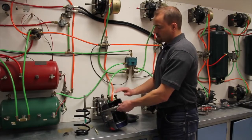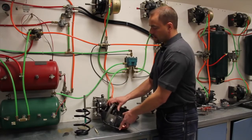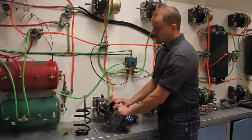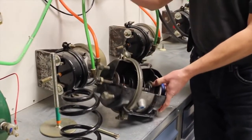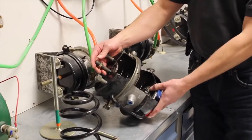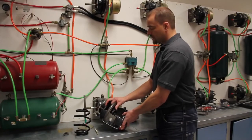This configuration — your adjustment limit for the brake — is 2 inches. What I'm saying is that your travel should be no more than 2 inches. In reality, we want you to be around an inch and a half somewhere in there. We'll talk about your service side.